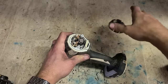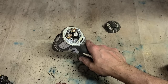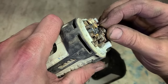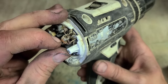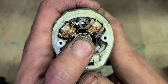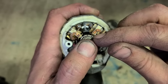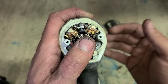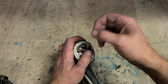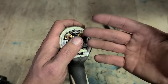If you plug a brushed cordless machine like that in, it doesn't work, but if you give the motor a bit of a slap and all of a sudden it sparks into life, it's always the brushes. As you can see there, them brushes are worn out. If you look at the armature, see this one here especially, see there's a wee gap. So they're worn down too much now, the brush is no longer making contact with the armature. So whenever you run it and it stops working, it's actually broken contact. Whenever you give it a slap, that brush just moves down ever so slightly, just enough to make contact again to allow it to run for a little bit. But once it goes around a few times, it generally stops.